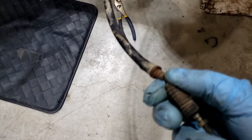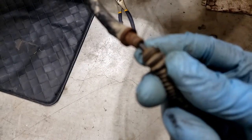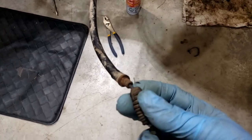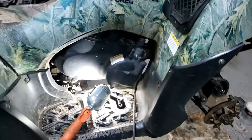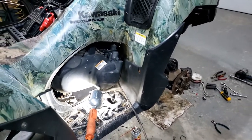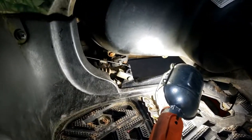Okay, so I got the brakes off the end. This one was easy because it does move. This is the handbrake one. All I got to do is slide it and get the cable to the groove and pop it out. It does move, but slowly. So I'm going to take it as far up as I can and then throw some cable lube in there.